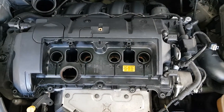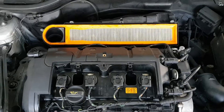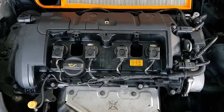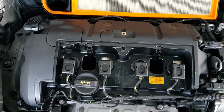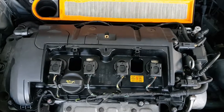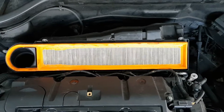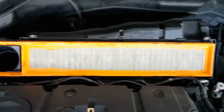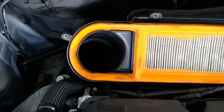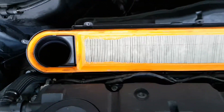Sorry about the background noise — it's the windiest day ever right now. We've put the rocker cover in and reinstalled it, then put all the wires and cables back in. We're not going to change the spark plugs today because we don't have the right socket. We've also put in the air filter. This is actually a European version, not a US version — just make sure if you have a European version you buy the air filter with the little 'U' at the end, because they do have slightly different intakes.